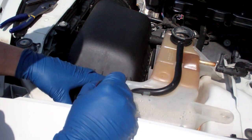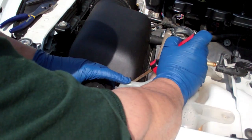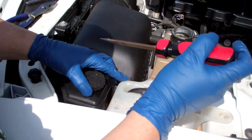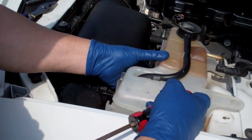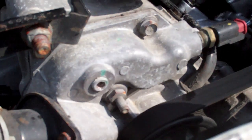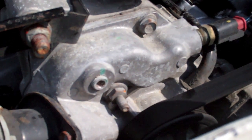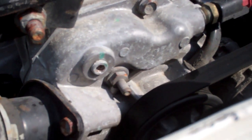As opposed to a regular plier, I really like these. Then there are two bolts here — these are 10mm. You get the power steering reservoir detached from there; you've got to push this little retaining clip. Notice that's the lower hose there — that one will come off the same way as the upper one did. I'm going to do that off camera. It's basically squeeze that clamp, slide it back, pull the hose out.